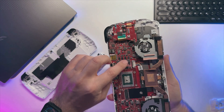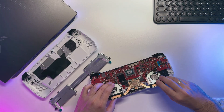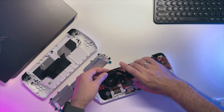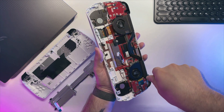Also not to forget, Asus used the bottom of the fan as a heatsink for VRM, which is smart. Putting everything back can be tricky since both fans are relatively loose. My advice is to align them first, then hold it in the middle and use one of the screws to secure it in place. After that you can screw the other 3 screws in an X pattern and you are good to go.